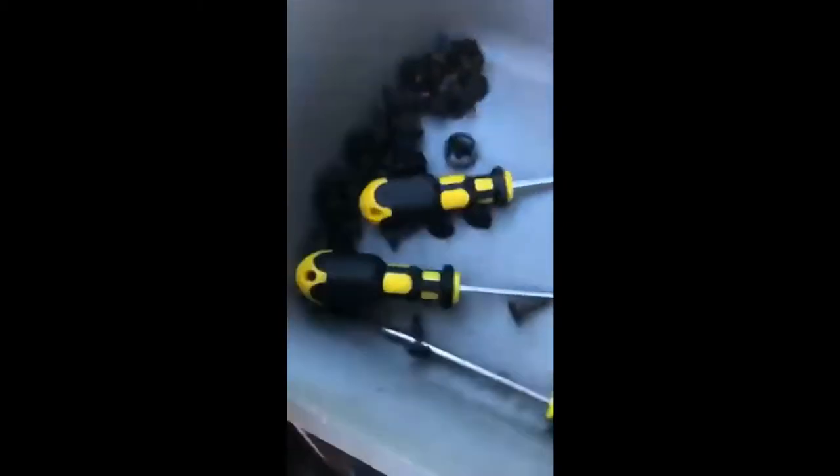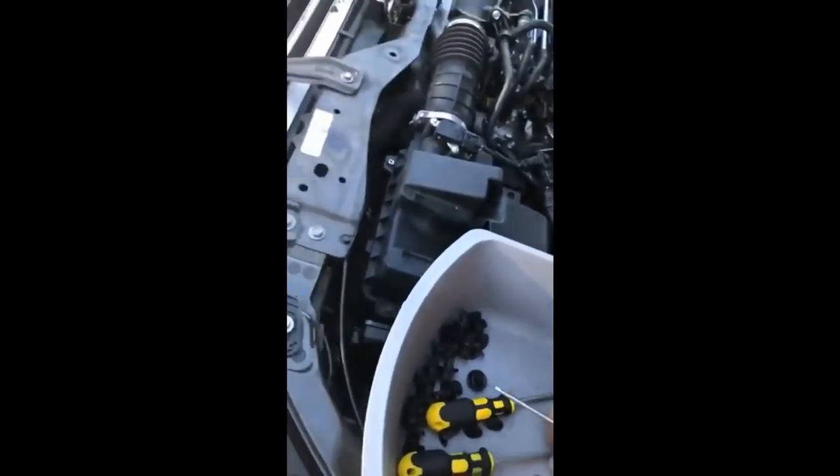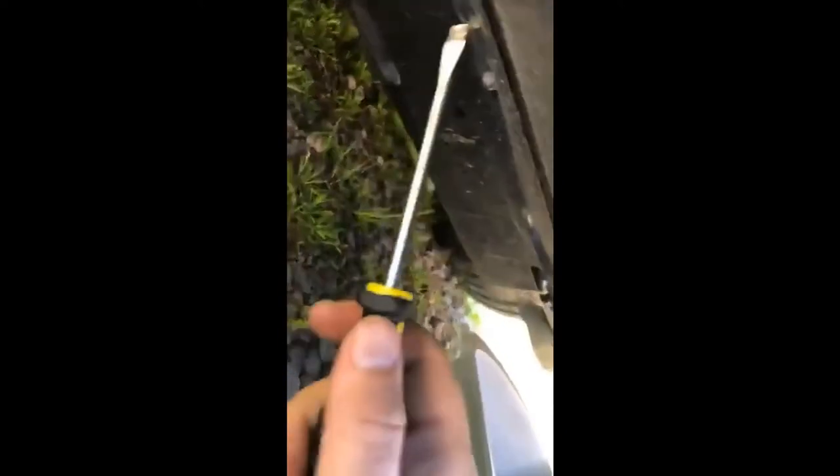The screws look like this. Now you want to grab your flat blade screwdriver again and crawl up under the car, grab your 10 millimeter, and start taking out these clips down here. Go ahead and grab a tub, pan, or anything you can keep your clips in — an old 12-pack box works perfectly. The part here stays on the bumper, but you're going to need to take this 10 millimeter out over here. Make sure to save that bolt.